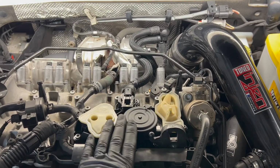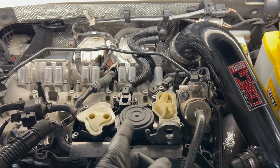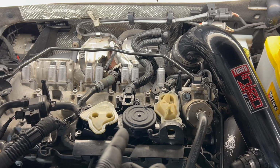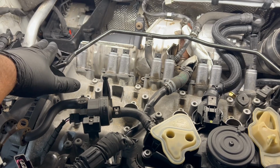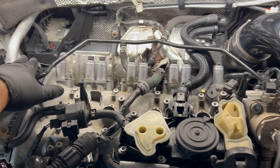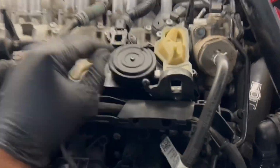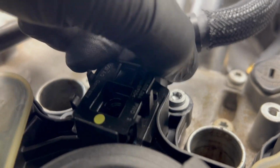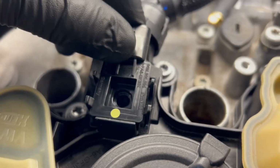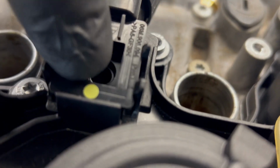So what the thought is on this is either A, this puppy was bad right out of the box, never stood a chance, B, the oil cap not being OEM caused a pressure differential that caused this to prematurely fail, or C, something I noticed popping under here to start my diagnostics today, this dummy plug could absolutely be a source of a leak. They do not fit all that well.